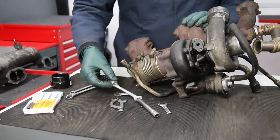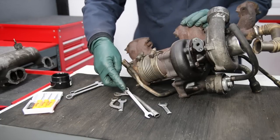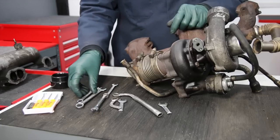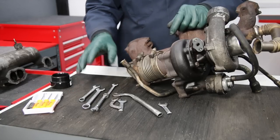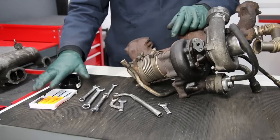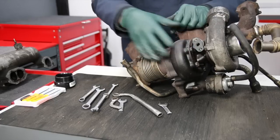This particular wrench here is not for getting the turbocharger off — it's for properly torquing the nut when you apply the compressor wheel to the turbine shaft. There are a couple of other wrenches included that you can modify if needed. The other tools over here are just for taking the center section apart and overhauling it; you don't need those to remove it from the engine.